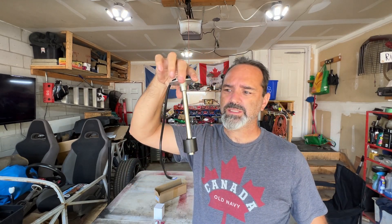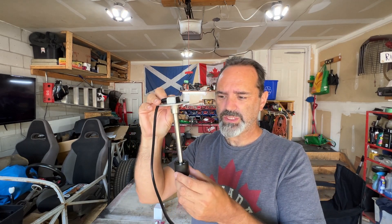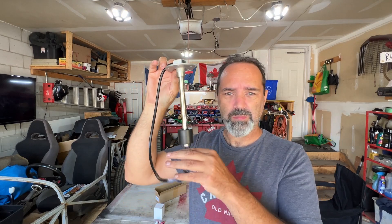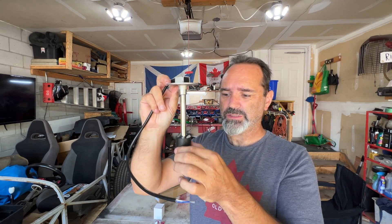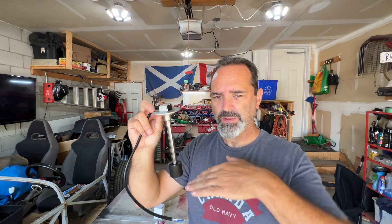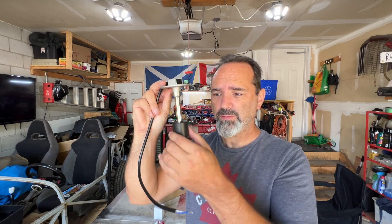I think the problem is that I've got quite a wide shallow tank, similar to what you might find in a boat. So I picked up a marine sender unit. These are quite specifically sized by length — I had to measure my tank first. My tank is around about seven inches top to bottom, so I've got one just under seven inches. If you get one at eight inches it's going to bottom out and not fasten. These do come with lots of different length options, and it just feels a lot freer than the arm-and-float thing with the little resistance piece — kind of like what you'd find in a slot car trigger, grinding as you press.